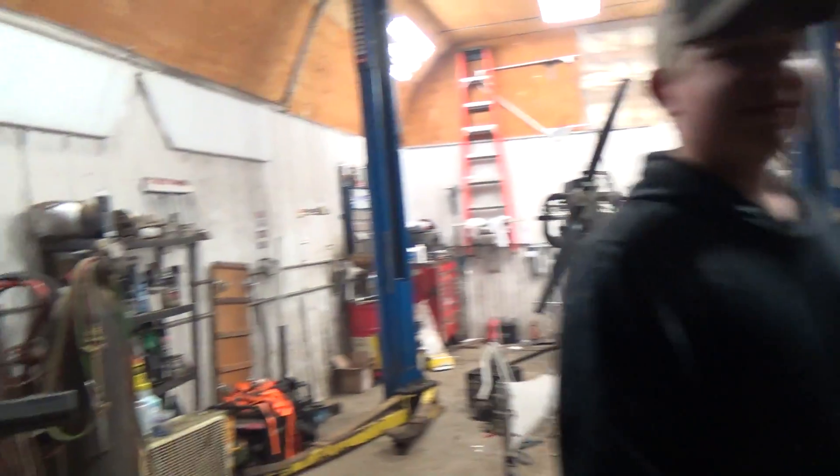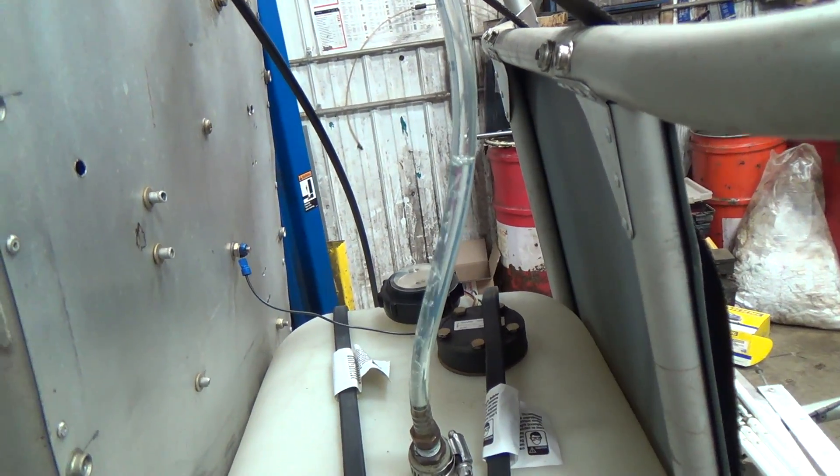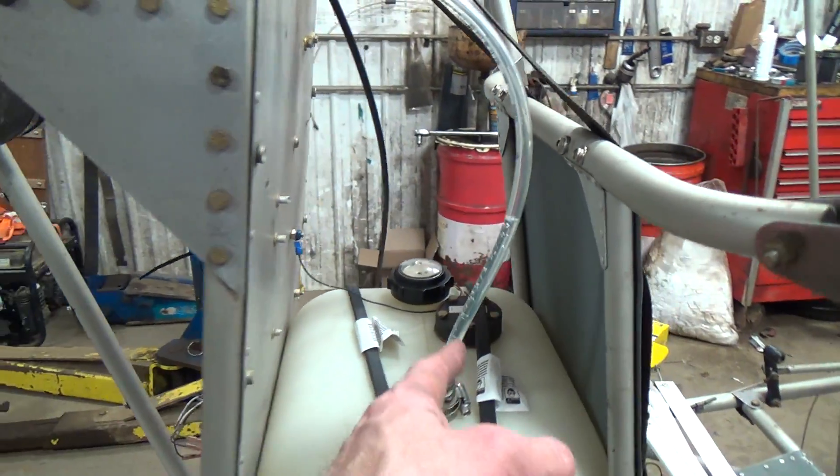It started to rain. If only we had a big fan to air it out. So it starts! It did start — didn't even take all that many turnovers to make her go. That was cold, we didn't prime it or nothing, and that's where it started up. I don't think any of the needles moved — the EGTs aren't hooked up, but the CHTs are, though it takes a while for them to warm up. Looks good, I don't see any leaks anywhere. It's drawing fuel from the fuel — you can see it doing that.